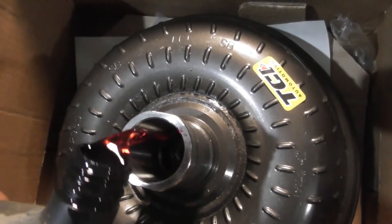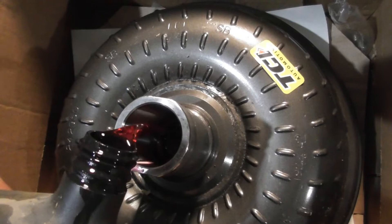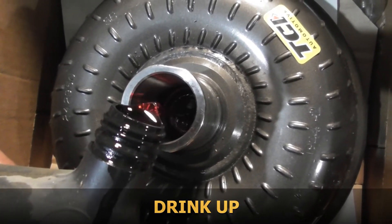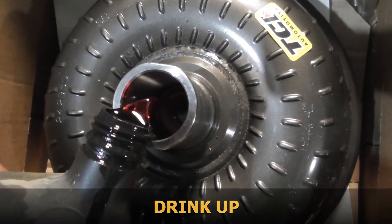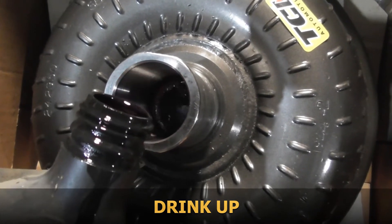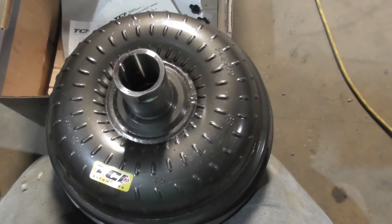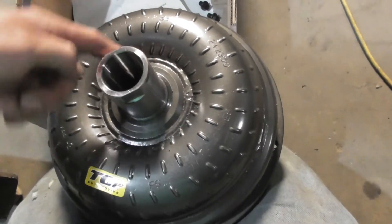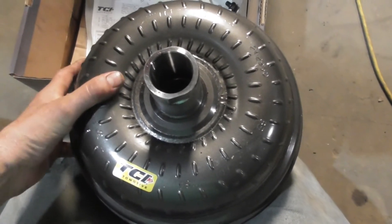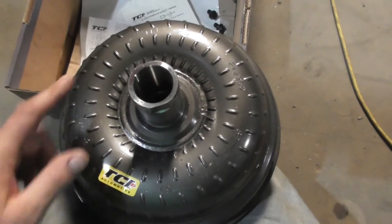Here you go, drink up. I did this before on the Impala and it went bloop bloop and there's puked oil everywhere, so I'll take it easy on it — I'm not going to fill it too fast. Okay, got her full of oil — almost a full quart. Smear some oil around the outside here so the seal isn't dry. I want to dump some oil in it so nothing's running dry. This thing's pretty heavy — it might slow me down. It's not like your normal 10-inch converter or 9-inch or whatever this is considered. It's pretty heavy — probably all that multi-clutch lock-up stuff in it.